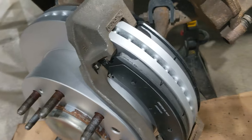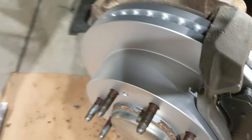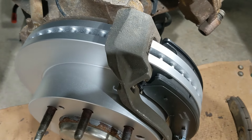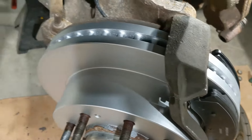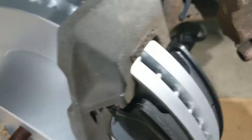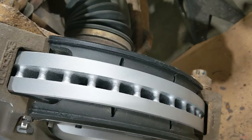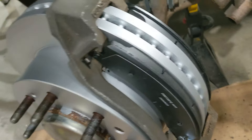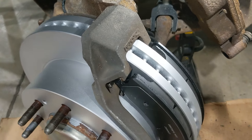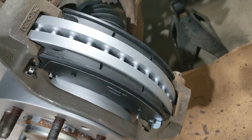If you're in a location where there's salt on the roads in the winter, do yourself a favor and buy rotors that have the full coating on them. These have been available for a few years now and I really like them. When you pull rotors off a rust belt vehicle there's rust everywhere, coming out of the air vanes — it's a big rusty mess. The coated ones hold up a lot better in the salt.